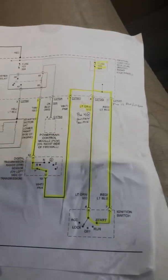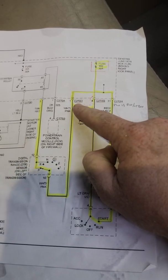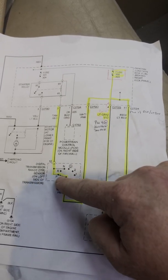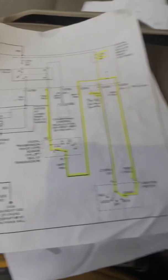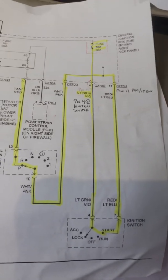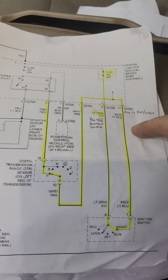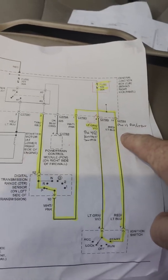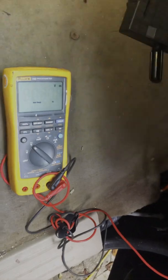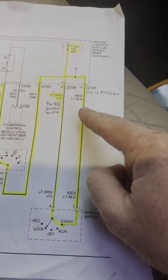All right, so we just checked this one — it's good. Now we're coming around to the white/pink wire on the back side; I'm going to skip that and go straight to the tan/red wire at C270A. If we don't have voltage here I'll investigate the DTR underneath the transmission. We've got 12 volts here — 11.8 on one side, 11.8 on the other. I'm not sure if the battery is slowly dying, but I'll continue. Now checking pin 11 on C270H — turning the key — 11.86 volts. I'll call that good.